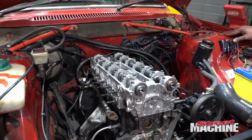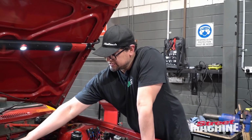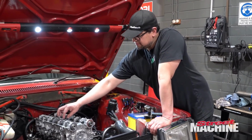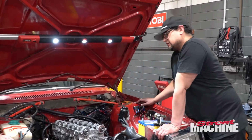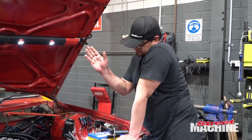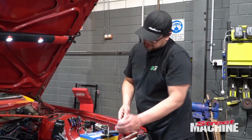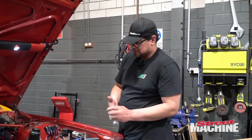There's still another 2 steps to this though. Is there? Okay. We want to make sure that the pressure is just acting on the cam with the lobe not working against it. So what do we do? Rotate the cam? So you rotate them. That's why you do them at 60 degrees. Okay, so we've got to rotate them. Sorry, 120. Okay.